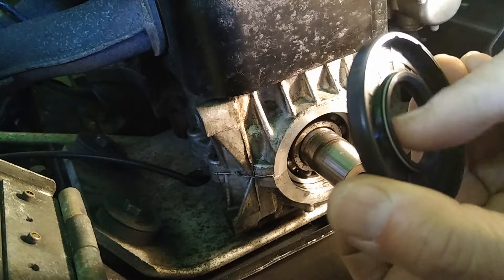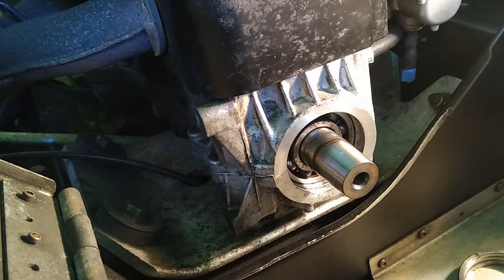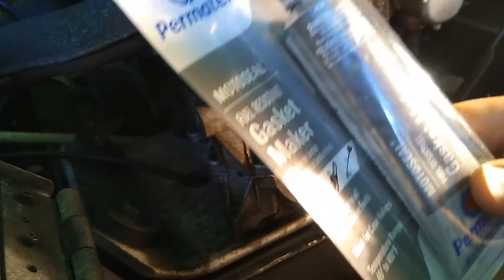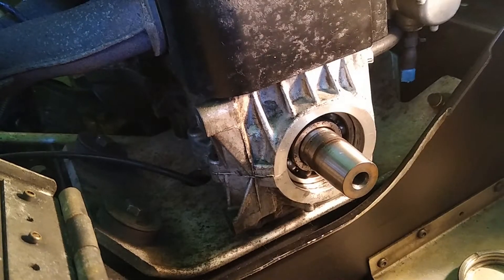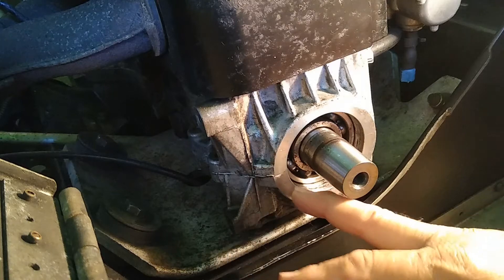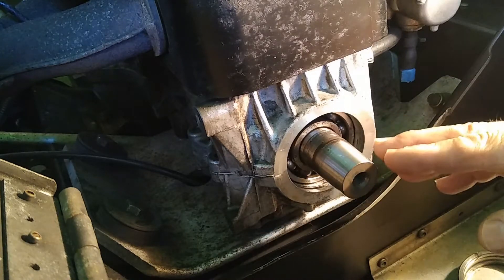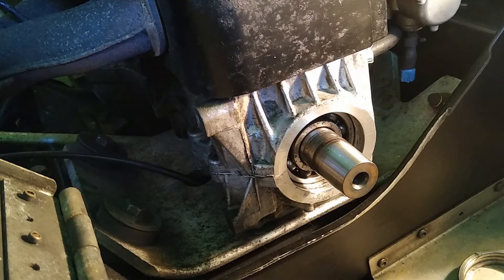We're going to put a little grease on the inside before installing it. On the outside we're going to use Permatex Moto Seal — put it in there in sufficient quantity to pack some in that groove. Even if some sealant gets pushed inside the motor, it shouldn't cause problems. This is a two-stroke engine and what's in the crankcase will get exhausted through the exhaust ports. It's not metallic, so it should just work itself through the engine if any of it comes loose.